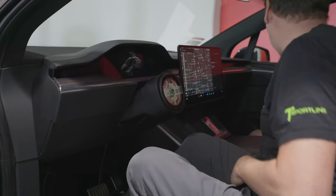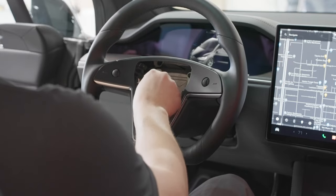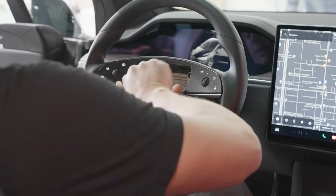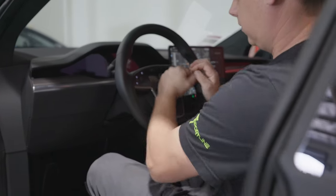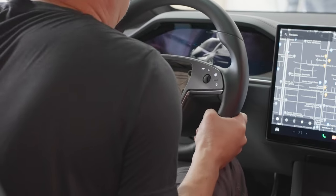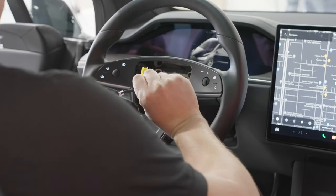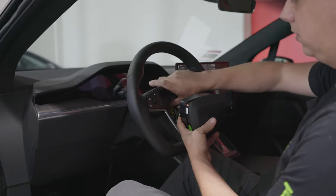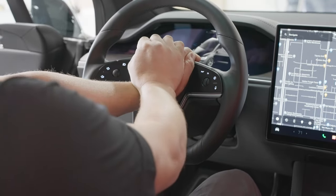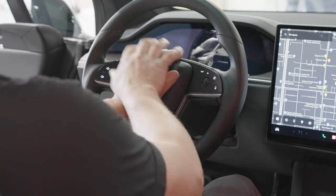Put your yoke off to one side, take your Performance Grip T-Sportline wheel up, drop it in place, click your brown plug back into where your brown plug was. Take your bolt, start it off by hand, get it in as far as you can, and tighten it back up. Once you have this tightened back up, take your airbag that you put off to one side safely and plug it back into the same plug you pulled it out of. Make sure it's clicked in position — when you line this up you want to push one side first and then the other side, and you want to hear those two clicks. If those two clicks don't happen, your airbag is not seated correctly.